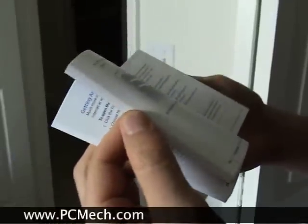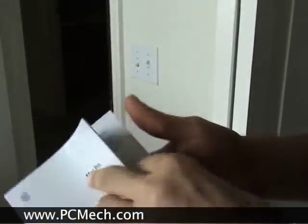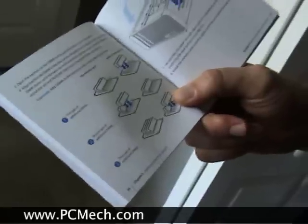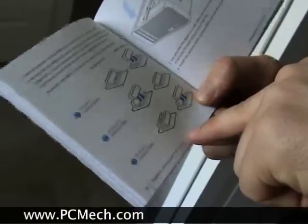We're checking right now to see if there's anything about memory — the memory bank situation. I've seen it before. PCI card, internal backup battery... optical, hard drive... ah, here we go. Second pair of additional DIMMs in the second bank on the first card. Okay, that should be okay. You can install additional pairs — it should all go on the first card, so we're going to see if it does.